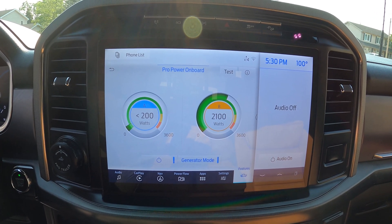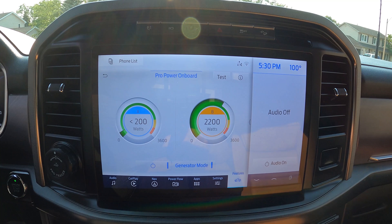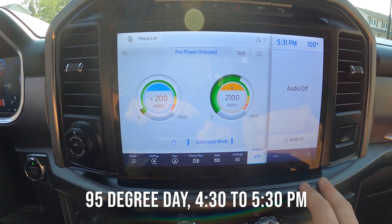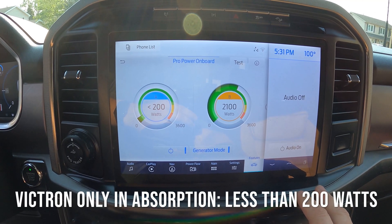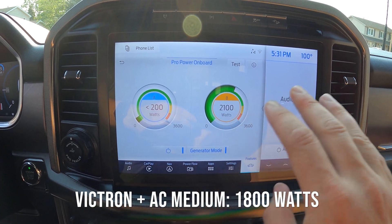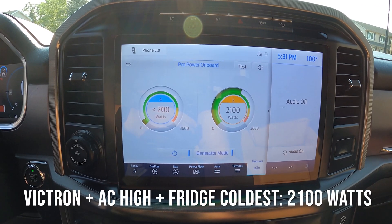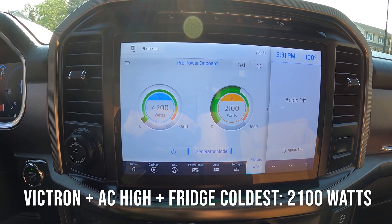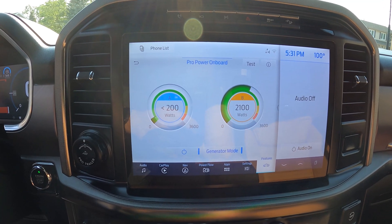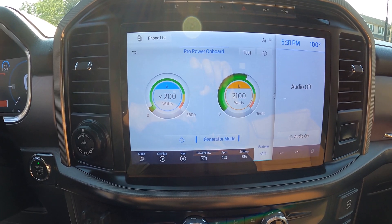The system has now normalized and the load has come down a bit. The charger is no longer drawing an additional 1400–1500 watts. Maximum draw: 30 amps, 3600 watts. The truck didn't like it, but as long as it peaked momentarily rather than sustaining a full 30 amps, it let it pass. So there's some tweaking to be done on this system — we've got batteries to add and programming to do on the MultiPlus. Still pretty functional, and interesting to see how much each device draws under worst-case scenario circumstances.